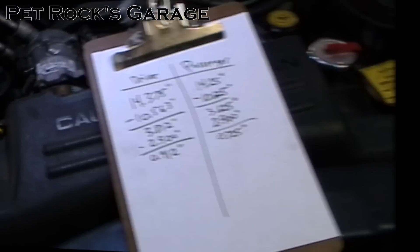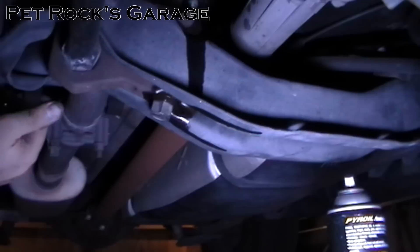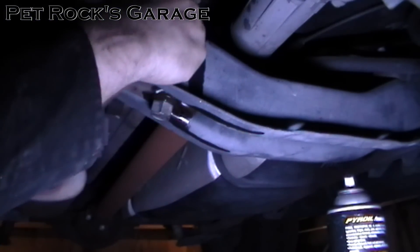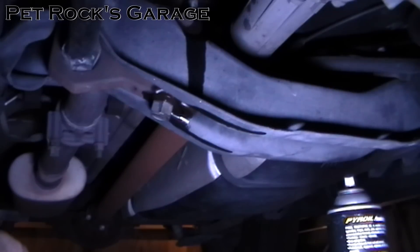Now we need to adjust it, and for that we move to the truck. We're at the passenger side torsion bar and torsion bar key and its adjuster bolt. You want to turn this clockwise to raise the vehicle up and counter-clockwise to lower it back down. I've already put some penetrating oil on the bolt to help loosen it up so it will be easier to turn. This will take some force because you are literally lifting the entire truck up by this bolt. Get a long breaker bar and a 15/16ths or 24 millimeter socket, preferably a 6-point rather than a 12-point so you can get as much bite on the sides of the bolt head as possible. You don't want to strip this thing out.